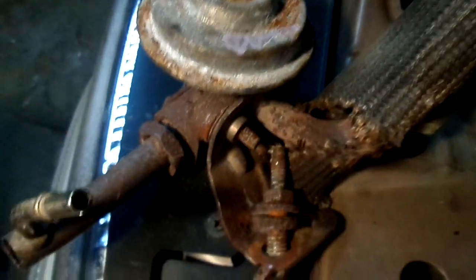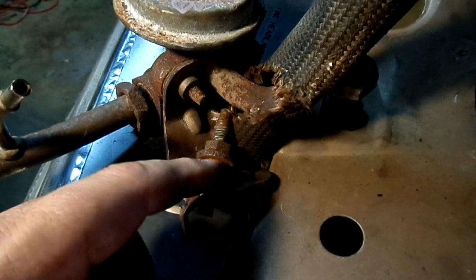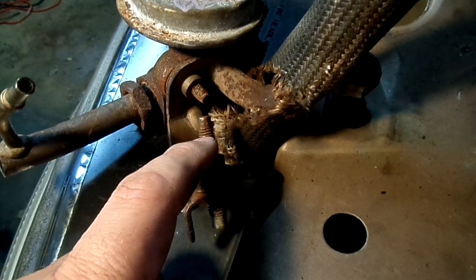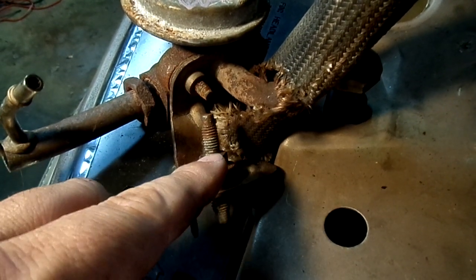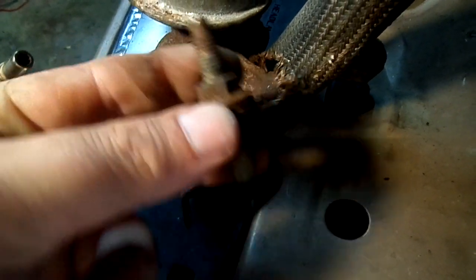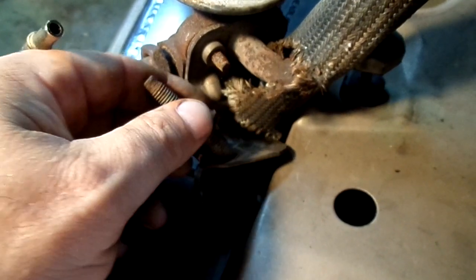Now if you're trying to get the EGR tube out, let's look at how the EGR tube is actually mounted. You'd have to take the two bolts that the EGR is mounting with on the side as well, because that bracket has three fasteners — one here, one there, and of course one you don't see. What you'll see is a 13 millimeter bolt sitting there, and then a triangle piece of metal that connects to the tube — the dipstick tube. Take the 13 millimeter off, get something underneath that tube lip, pull it up over it, and then you'll be exposed to the 13 millimeter, and usually the whole stud comes out. They almost always do — it's not supposed to, but it does. And then you can take just your tube out without removing anything else, because once you remove this, the tube is just going to slide.